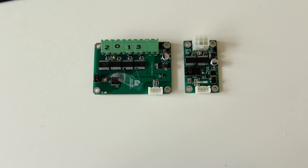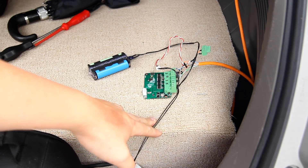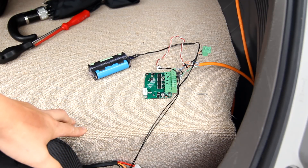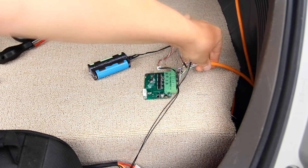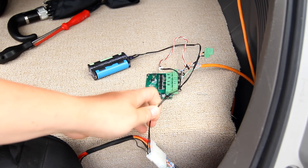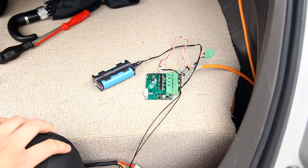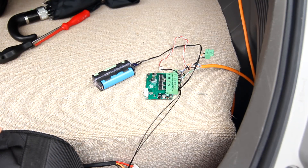So enough talk — let's build them into the car and see what it does. This is the extender board installed. Obviously it's going to be potted and in a good enclosure — it's not very safe right now. The first three CAN buses go to this orange wire which goes to the extender, and then these wires go to my main connector that goes into the EV CAN bus. There is a battery temporarily as a power supply, so if everything is functioning I should be getting messages from this board at the front of the car where the EV CAN bus comes out.